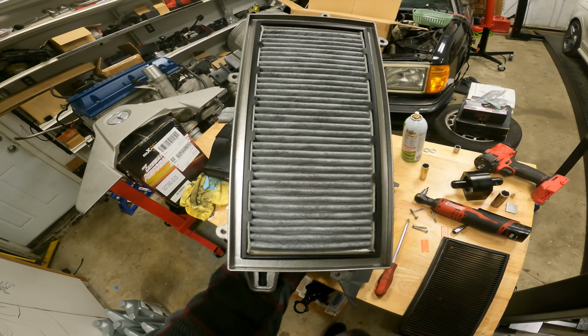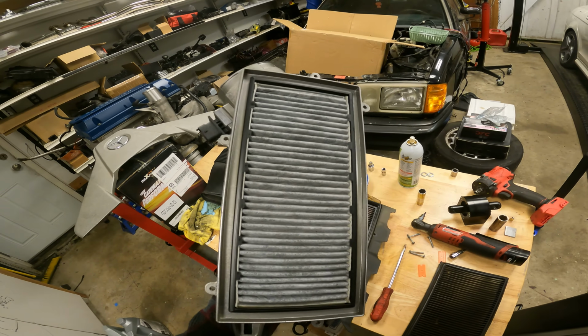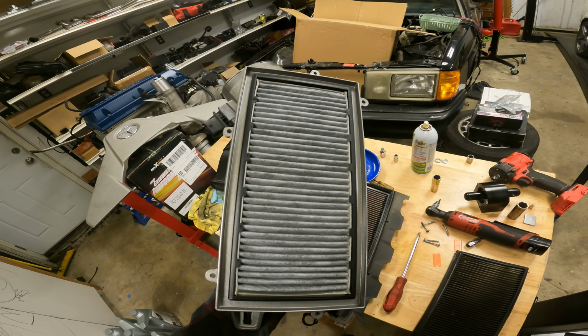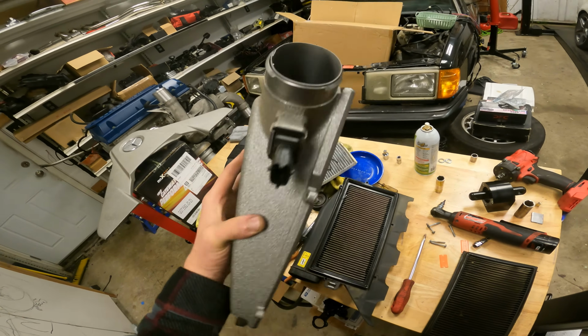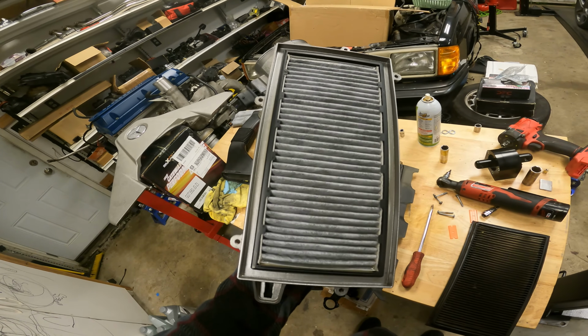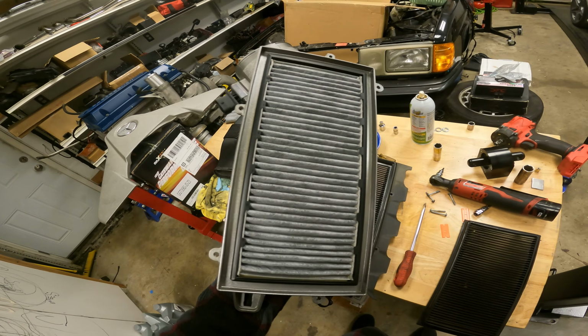You got this charcoal filter, basically the same thing you'll see as a cabin filter Mercedes uses. I don't know why they have these on the engine bay necessarily. Maybe just another layer of protection, but yeah, it's definitely strange. Maybe it has something to do with keeping the MAF absolutely clean in all scenarios. So very well could be, but rest of world boxes don't have this, so I'm gonna say it's okay to run it without them. And I did my ML63 and ran it for at least 20,000 miles after I did this mod, and it was totally fine.